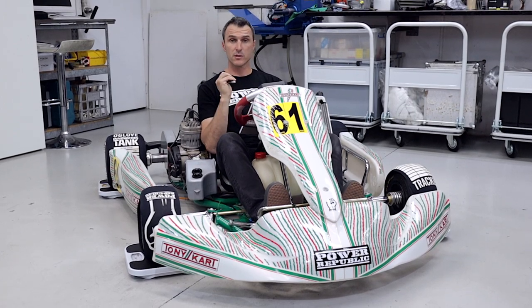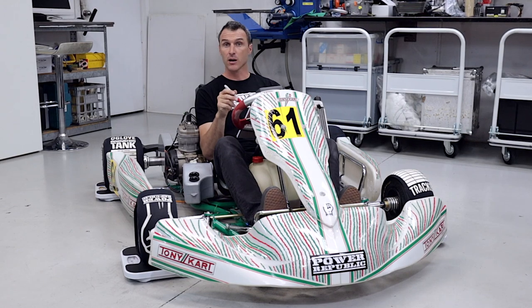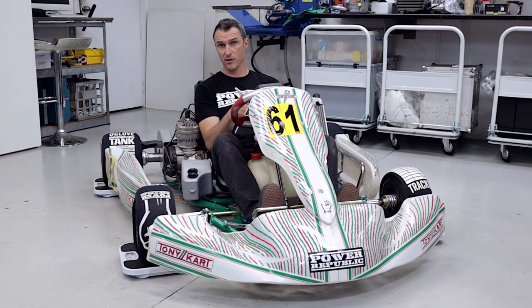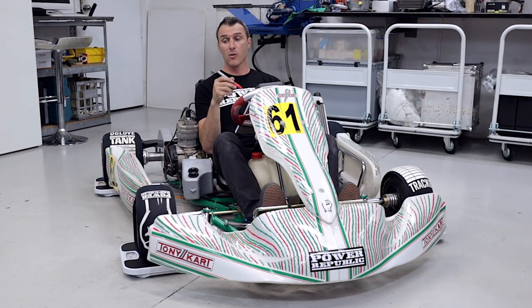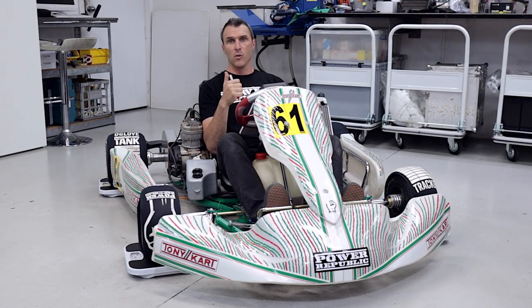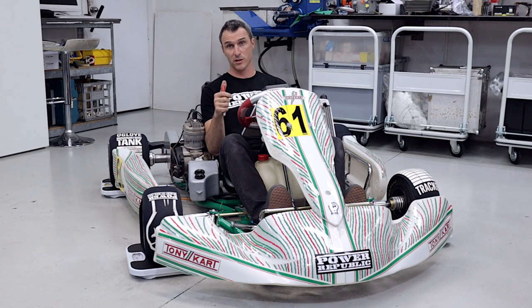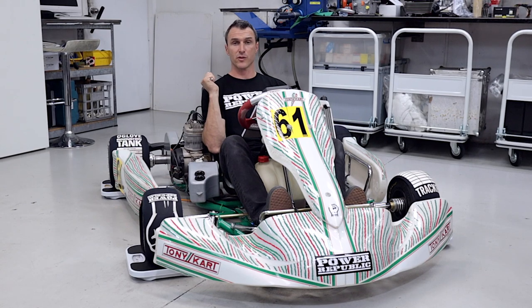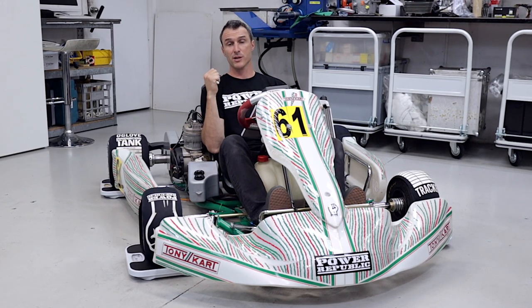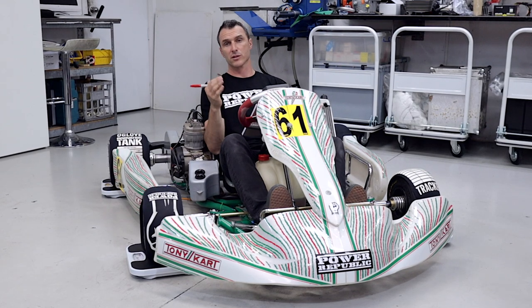As you can see, this go-kart is weighted a little bit heavy in the rear. So if we needed to add lead — which we do — we'd start adding it to the very front of the kart, or we'd move the seat forward. This 60/40 split means the kart will have good acceleration but maybe a little understeer, as opposed to the classic 43/57 split where the kart is more direct to steer. It really depends on the type of tyres you're using. If you've got a sticky tyre that's always understeering because the rears are overpowering the fronts, you'll want to move weight forward by moving the seat forward. If you're always lighting up the rears, put a little more weight to the back to cure oversteer.